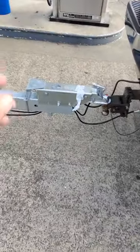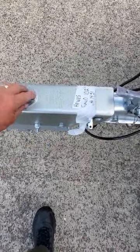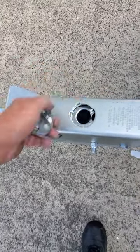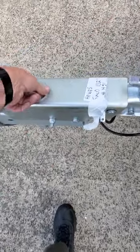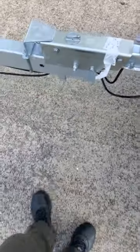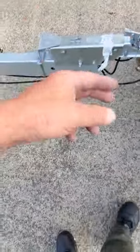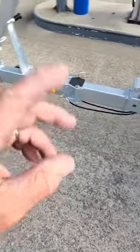You've got the top-mount coupler. Check the brake fluid right up underneath here — if this is pulled all the way out, you can just twist, pull the cap out, pull this. Brake fluid's good. Then if you have to back up and you're not hooked up to anything, you go like that, or you can use this clip right here. You've got a two-inch peek-a-poo hole, a standard flip pin. You've got cable instead of chains, which is good — safety cable for your brakes; if it disconnects, it locks. Always cross your chains or cables.